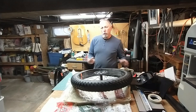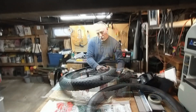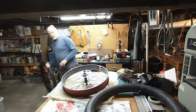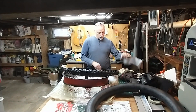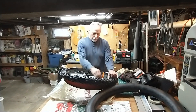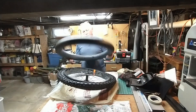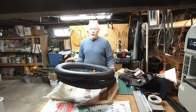Now what I'm going to do is pull the tube out, then take the tire completely off and get the other one on the rim. There we go — tire is removed. Here is the CST toboggan. That went on really easy. Believe it or not, it's actually recommended to have some air in your tire or tube when you put the tire on, because it'll help hold the tire onto the rim.